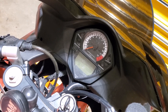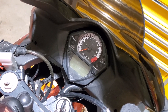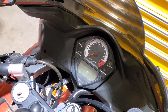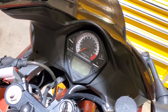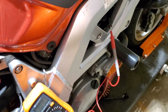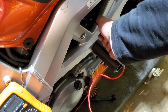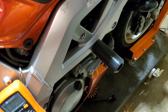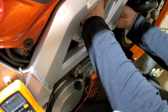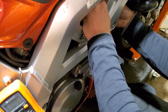I'm thinking my cluster might need to be reset, or maybe because I popped the battery out recently it got confused. But what you're looking for is 5,000 RPM and over 70 volts AC. I need to figure out what's going on with my cluster. The last thing we need to do — and we can plug this connector back in now and let the bike charge itself — is check the output from the regulator rectifier at the battery.